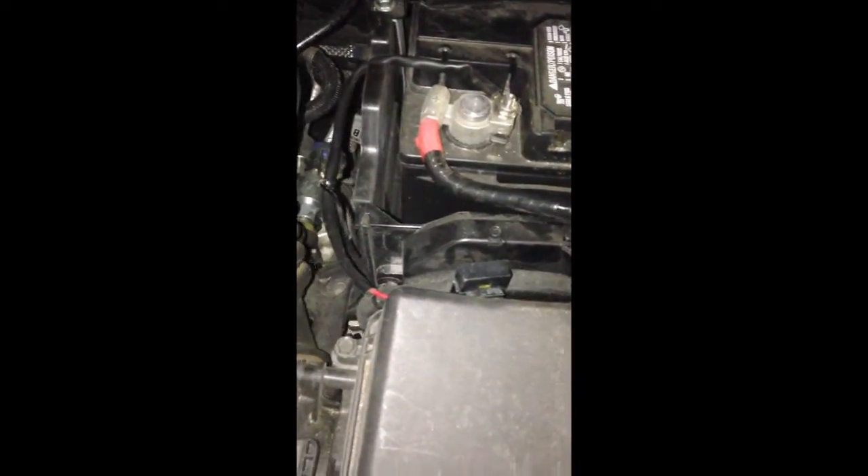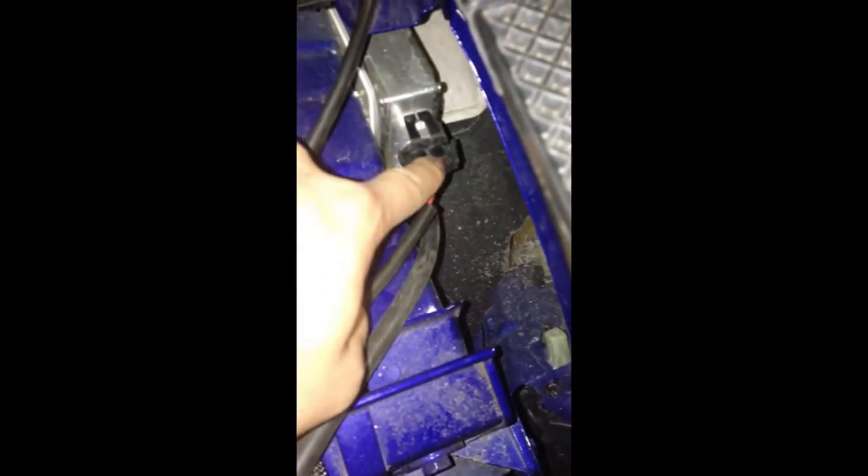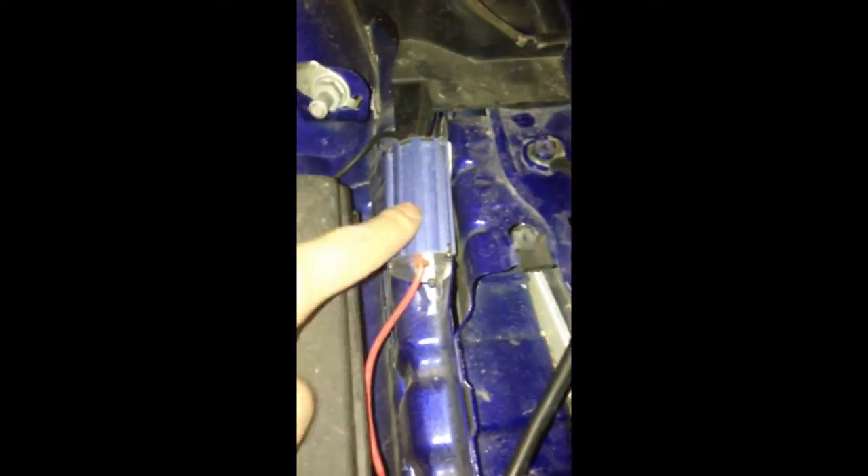It's about the wiring harness. Essentially this will connect to the passenger side over here and it'll go to the driver's side. This is the driver's side connection right here. It'll connect to your battery — the positive side will go to your battery — and to a ground. I have my ground right here. I also have, for this car specifically, because I get an error or a low beam fault on the car when you do this.